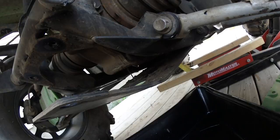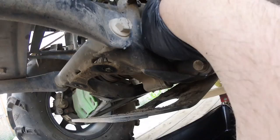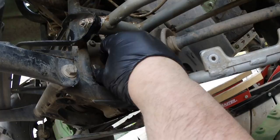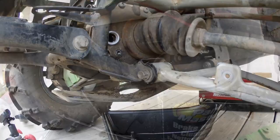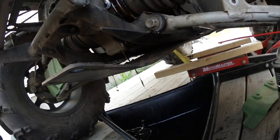Now we're going to remove the small one — it's an eight millimeter. And then this big one right there is a 17 millimeter. I guess that kind of explains why my 4x4 actuator got hooped — the differential would have been frozen and would have tried to engage. Need to take some brake cleaner and spray it inside to flush any of that out.